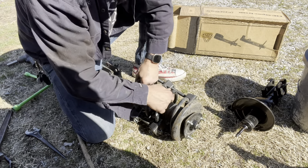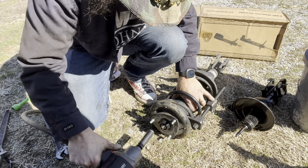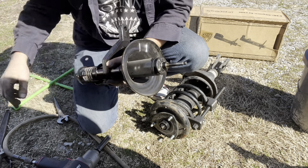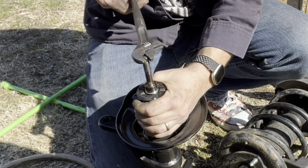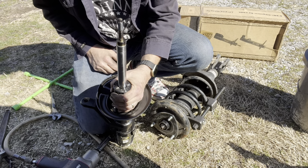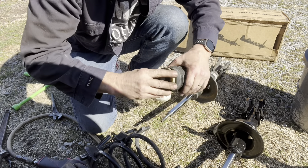These clamps are rentals from AutoZone — I went and got them for sixty dollars and when I take them back they'll give me my sixty dollars back. Put the other one on. It's got enough compression to actually move inside the casing, so that should be enough. Let's zap this off and we should be ready to go. There are instructions on this that tell you the way to get this thing out of its compressed shipping state is by turning it probably half a turn and it'll just pop out. Quarter turn was really all it took, and there she goes.